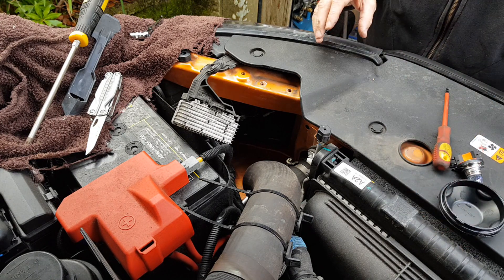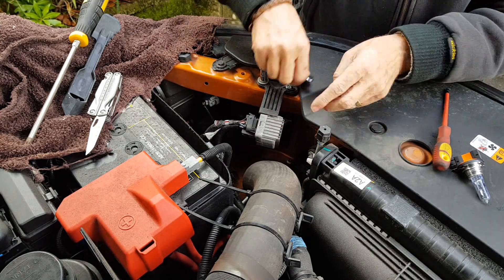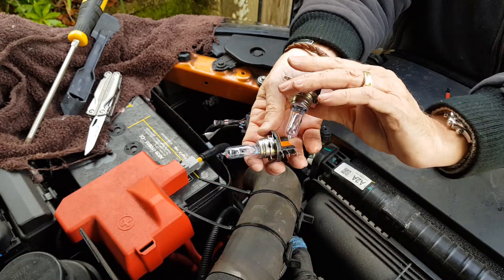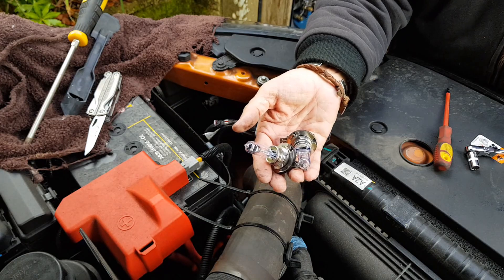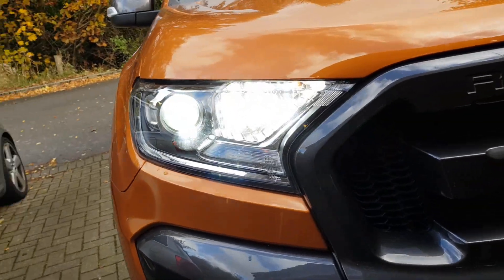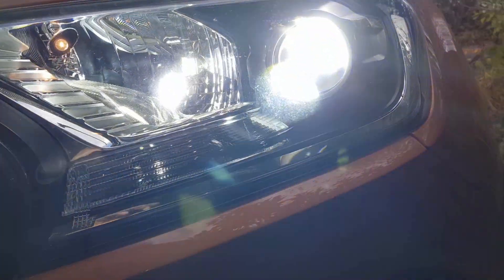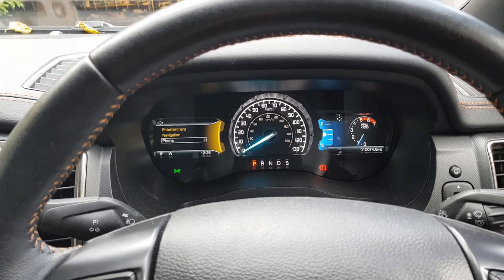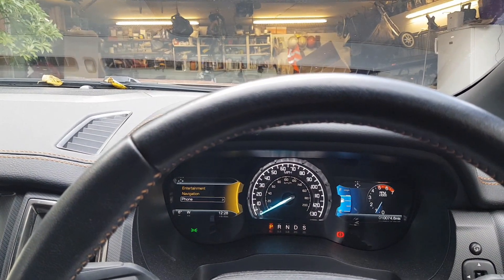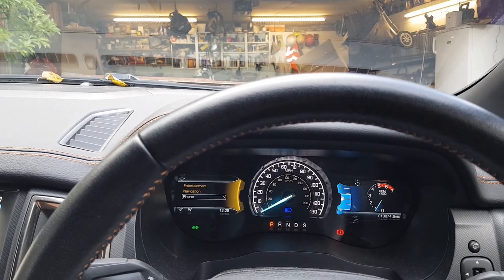Right, let's get the cap back on. So we've just replaced those two with LED bright white replacements and the lights are working on both sides - the daytime driving light and full beam all in one. Let's go in and check on the dashboard. Right, for the final test we'll flick on the low beam - there it is. Now put the low beam on and then flick on the full beam - and there we go, no error message. Perfect.